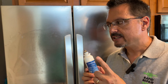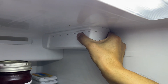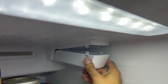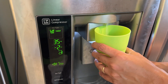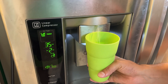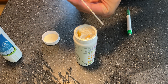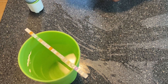Let's do one more test — let's test raw, completely unfiltered water, and see how much of an improvement we get with a new expensive filter. We'll take that brand new filter back out. There's a little valve in here that closes up so we can still draw the water. This is completely unfiltered water — I'll dump it and run it a couple of times to make sure I'm getting truly unfiltered water. Dip the test strip in for two seconds, then remove, and we'll add the results to our chart.